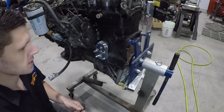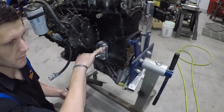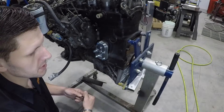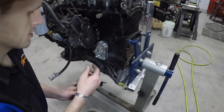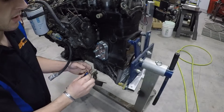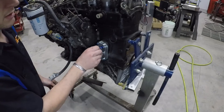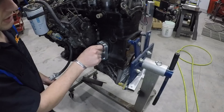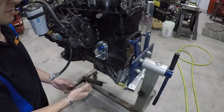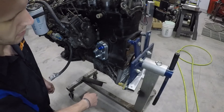All sorts of things out there use NPT, so it's an awesome universal thread size. This port up here is M14 by 1.5 — that's the factory size for the turbo hard line. You can massage that factory hard line around (I have another video on that), or you can get an adapter fitting with a little crush washer in M14 by 1.5. That threads in and you tighten it down, and now you have a dash 6 AN fitting to route a custom stainless braided hose to your turbo. If you trash your hard line, there's an aftermarket replacement option — so don't worry.